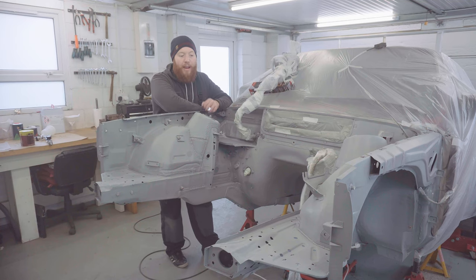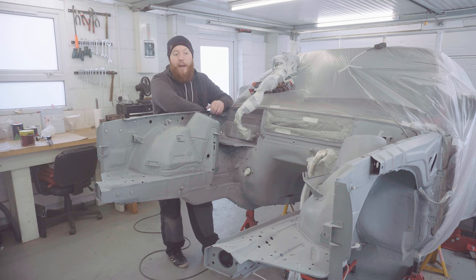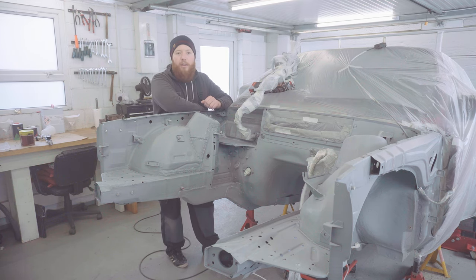Now, the colour I have chosen is a metallic, which is a big hint for you there. The thing with metallics is, if you've got sanding marks, the flake in the metallic tends to sit in them, and that causes you to have an uneven metallic finish in the paint, so I've really got to avoid that. So I'm going to use 3M Scotch-Brite red pads to key everything up to a matte result, ready to take on a base coat colour.